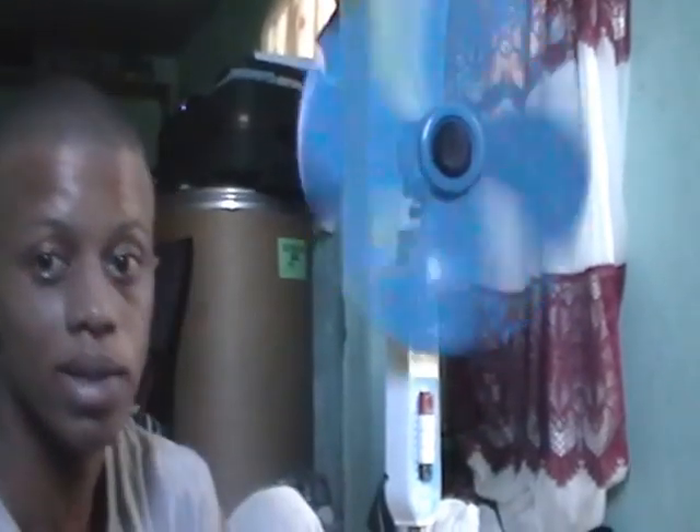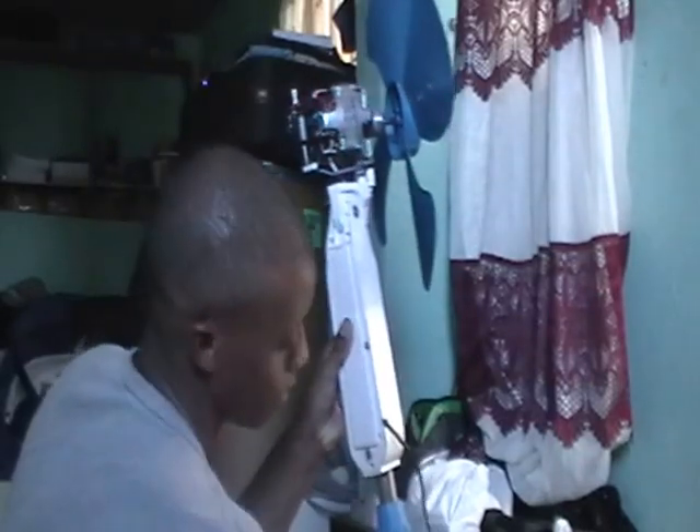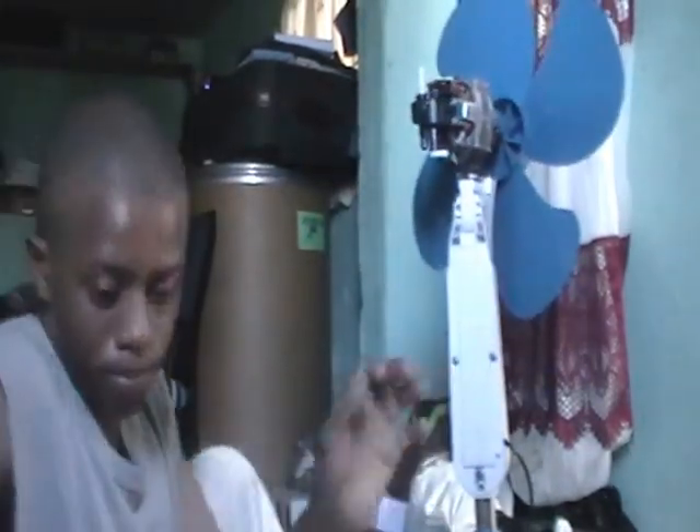So we're gonna test it. I'm gonna unplug this — always remember never to work on an appliance that's plugged in. Always unplug your electrical appliances if you want to mess with electricity. Trust me, that's one battle you won't win. I'm gonna show you what the capacitor is and get it out of the circuit. Here is our capacitor — this little black box right here. Before you touch one, especially one that has been in use, make sure it's shorted out.